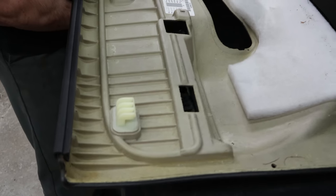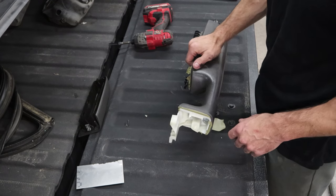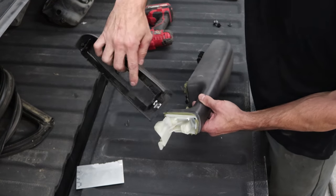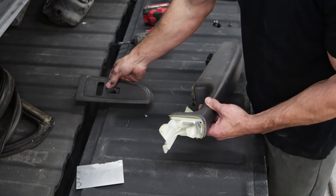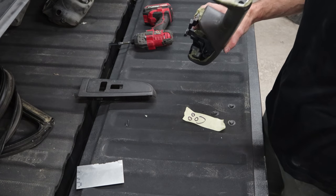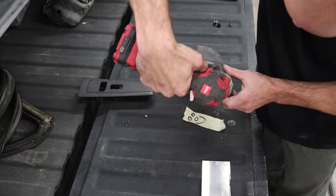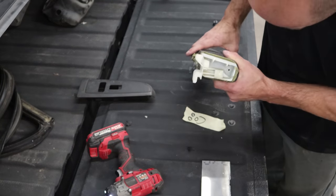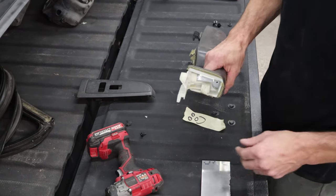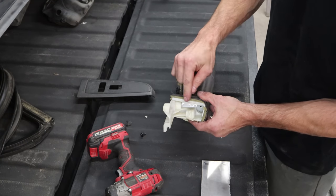Pull our armrest out of the door panel. In a perfect world we'd buy new parts, but we're not building Ferraris — we're building old Chevy trucks, so we're going to fix what we have. This is supposed to have a little rectangle cut in it so that the clip can clip into it, but there's nothing in there. It's pretty common on these; this part costs about 100 bucks, so rather than spending that we're just going to fix it. It'll take about a half hour. We're going to take this fancy little aluminum piece, cut it out, take this mystery screw out that doesn't seem to hold anything. We're going to make a bracket that comes out here, goes over the top, then we'll screw a screw in down here, cut our little slot in there, and it'll clip right in.